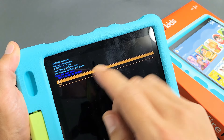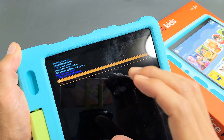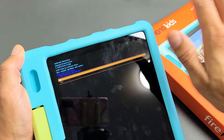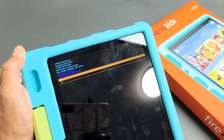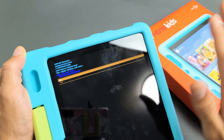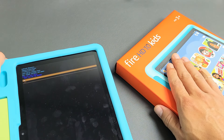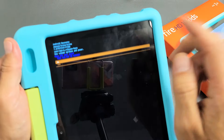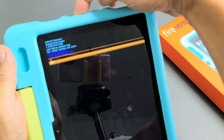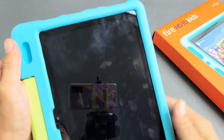To select it — this basically says this cannot be undone. Remember with the factory reset, you're basically deleting and erasing everything on there. All your photos, videos, Wi-Fi passwords — everything. Once the factory reset is complete, it's going to be as if you brought this brand new and took it out of the box. If you want to proceed, go down to Yes right there and tap on the power button.